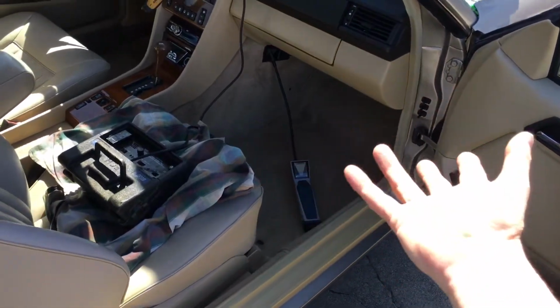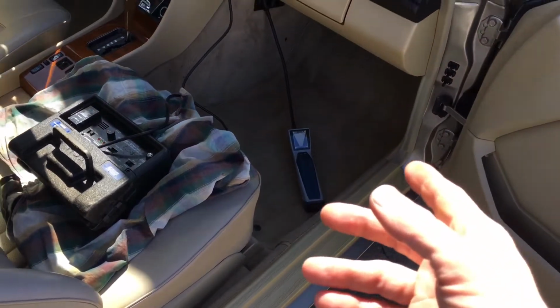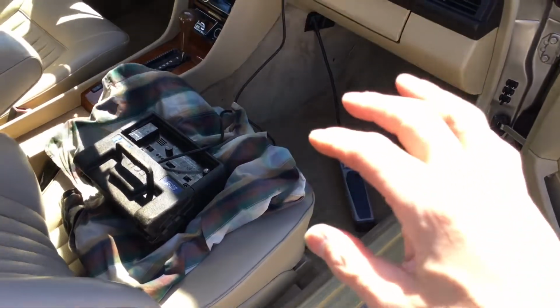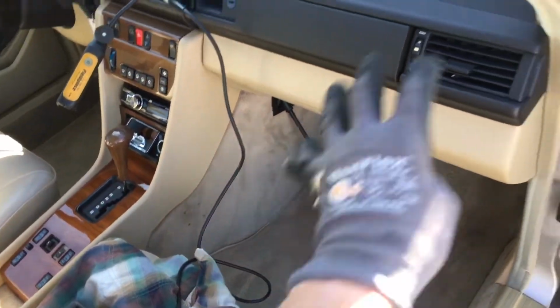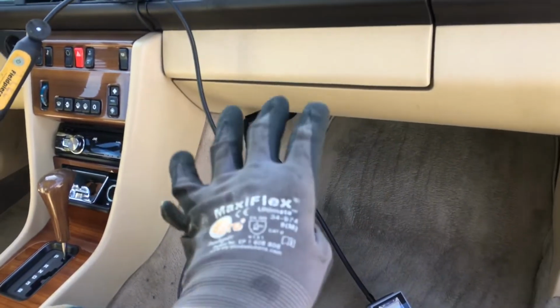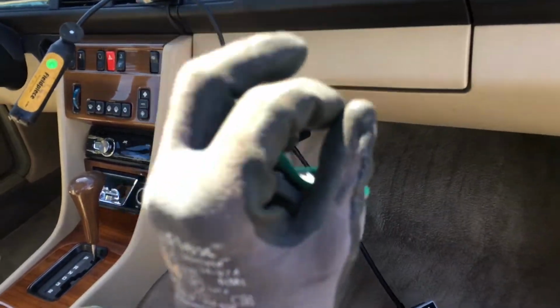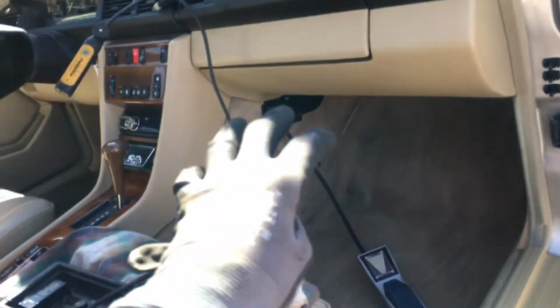Okay, video 5 or 6 of this Mercedes for checking for refrigerant leak and the condition of the system with only 60 some thousand miles on it. So I went over the entire system with a stagnant pressure of refrigerant in it under first fill, and it came in nearly empty at 29 psi.